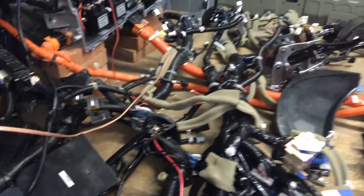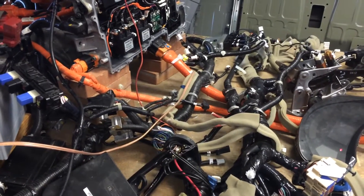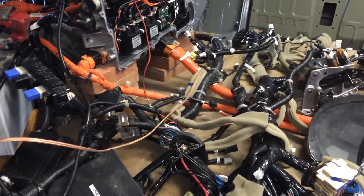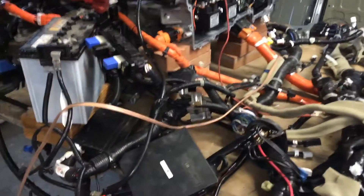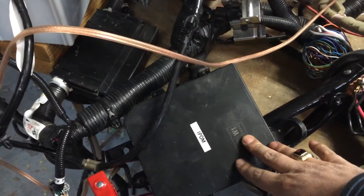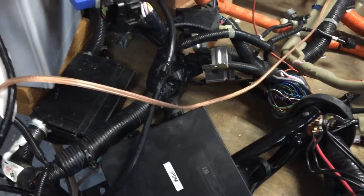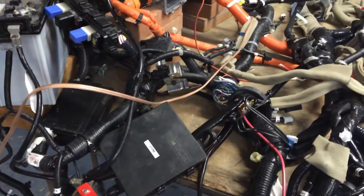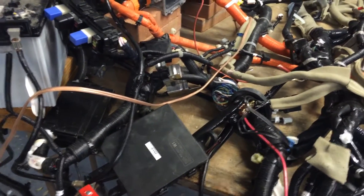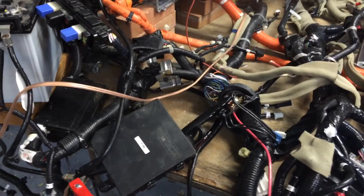Most of the wiring harness is still here. You could replace it, but it would be a lot of work sorting out wires, so if you're able to use it from the original vehicle that seems like the best place to start. The IPDM is unique in that it's a relay box but also contains a CAN controller, and it talks to all of the other relay boxes. Anytime a relay opens or closes, it also sends a message to the VCM to ensure consistency. Without that CAN controller you would have problems.